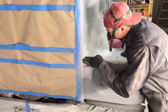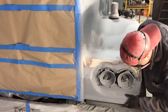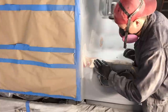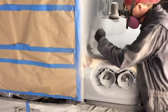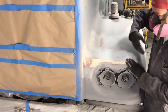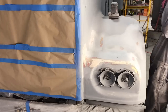So yeah, it's just a matter of putting in the time. I didn't put enough hours or enough effort into around the headlights, but that's okay. Now's the time to fix it up. So I'll sand it down smooth. I'll probably put a little bit of filler in some of the spots there with the pinholes and some of the low spots. And then we'll sand that down again. And then again, we can wipe it down, and I can spray primer on this when I go to spray the cans and the visor. All right, keep at it.